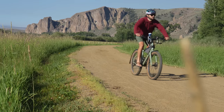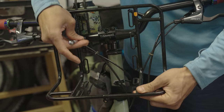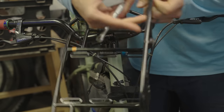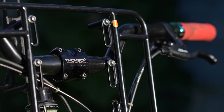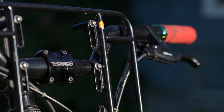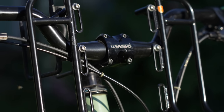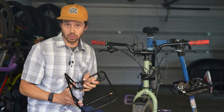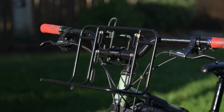Both the flat and riser bar are rated and approved for mountain biking. The unique offering from Velo Orange is not necessarily the riser option, but the mounts on the bar. The riser bar has what they call alien eye mounts that protrude upward from the bar itself, and it also comes with two mounts inside the bar. These mounts allow you to fit their sold-separately utility rack — a unique L-shaped rack that mounts using four M5 bolts.